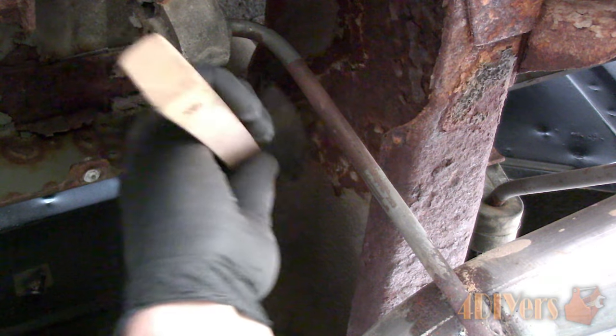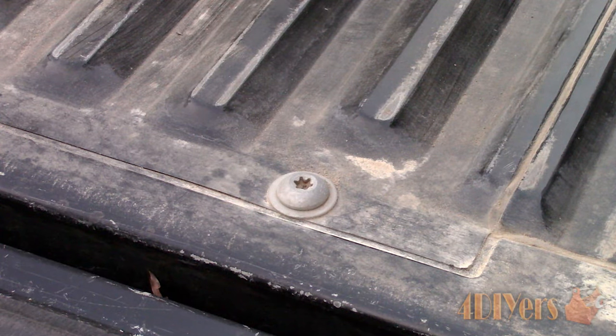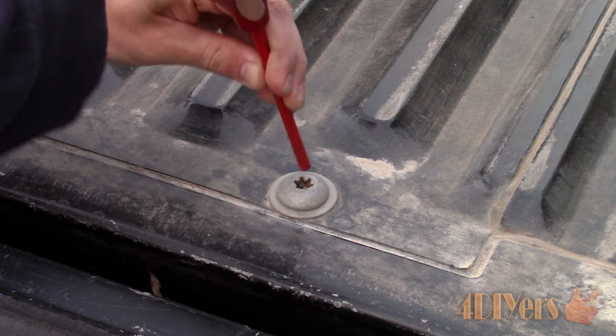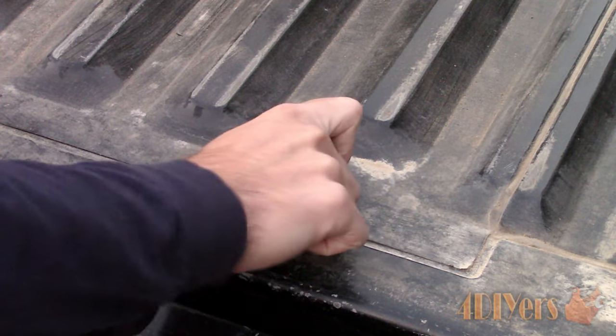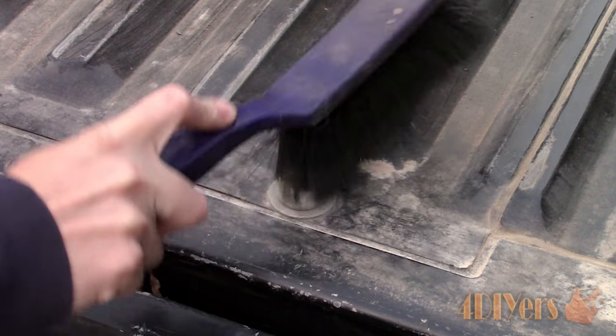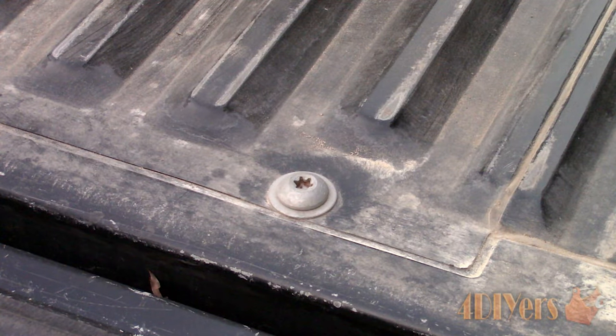While this truck did have a box liner, the bolts are filled with some debris. Use a brush, pick, nail, or even a wire brush to clean out the heads of the fasteners. If they're not clean we may not have good contact for the Torx bit, risking the chance of stripping the head. If that happens you'll either need to cut, grind, or drill the bolt. Blow out any debris and even insert the bit, which may help loosen up debris.